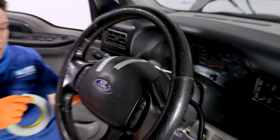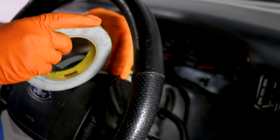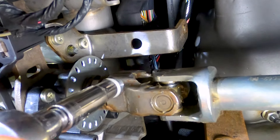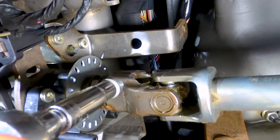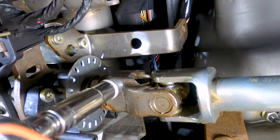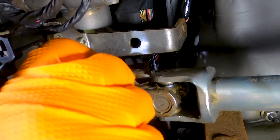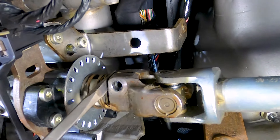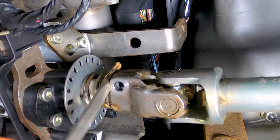A couple of pieces of tape here — at least it will give me notice if it starts to spin. Now I'm going to take this bolt out. It should have some thread lock on it — that's why it's not a freewheeling bolt — and we're going to reapply thread lock when we put this back in. The last thing you want is no steering because the shaft fell into the floor. You can just wobble it and bring it down enough so you can unbolt it and everything will pull right out.